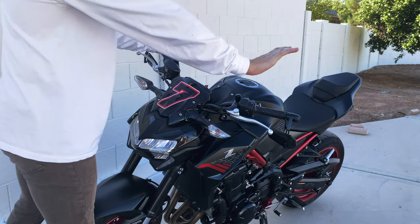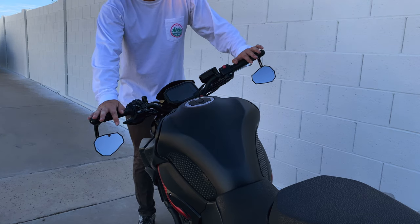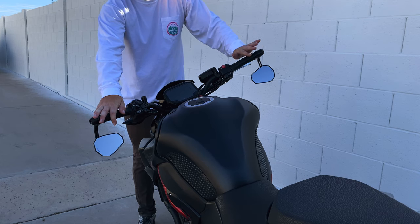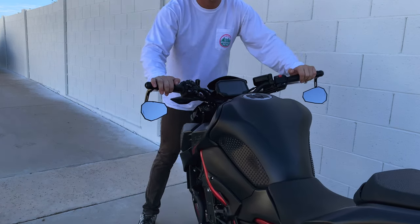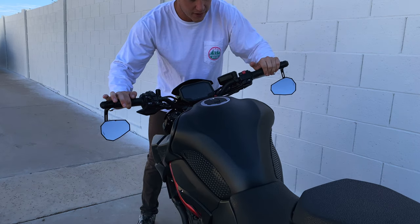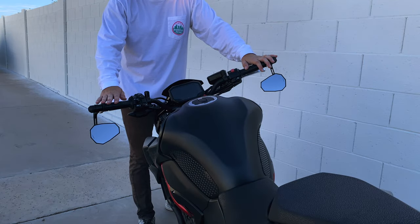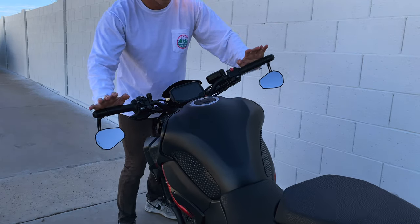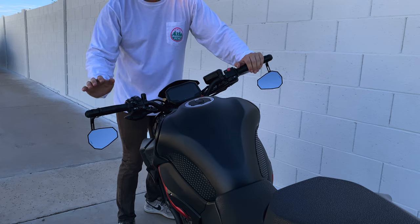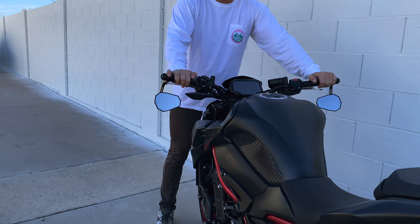See — it actually pushes to the right. Here's one more angle to demonstrate how this works. To get the bike to shift to the left, I'm going to push on the left handlebar — it comes up super easy. And same thing as before, if I push on the right side, the bike doesn't want to go anywhere; it wants to lean to the right. So we push in the direction that we want to go.